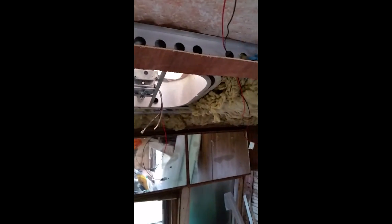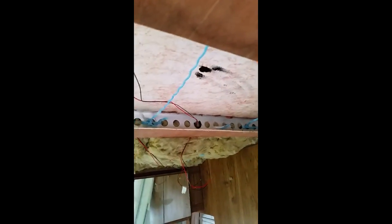All the wires are run for the 12-volt spotlights. You can see them here, here, here, here — it's a bit of a mess. The strings are for the insulation which will be up. These two straps have now been glued in place. When the ceiling there — that's the skylight hole — goes up, it will be glued with aquatic glue to these and then propped from underneath while it dries. I've just got to insulate these two here and we're ready to install the ceiling, which will happen today.